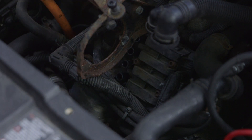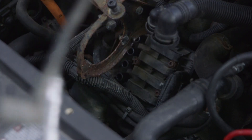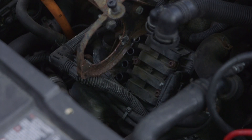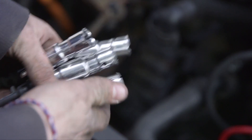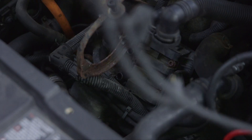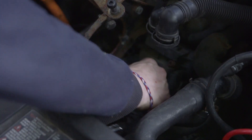There we go — there's all our old spark plug wires. You might want to save these because they're not necessarily bad, and if something happens you can use them until you get a new one. These are our new ones — they look a little different, but when I ordered them I made sure they were for my car's year, make, and model. Make sure you do the same. Let's start by plugging in the top one — number one.